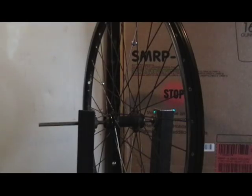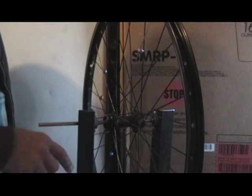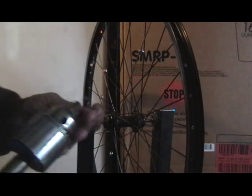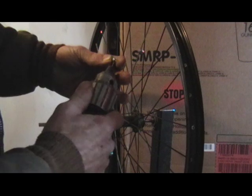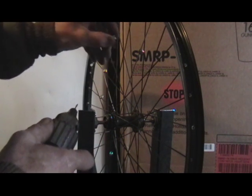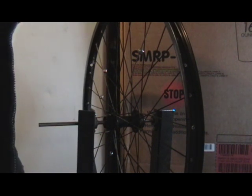Alright, this is going to be my final try. This is Zane, getting a decent recording of how to balance your wheel. What I use is split shot — I've taken a very small drill bit and put it across the inside of the rim, making sure I had a nice little slot in there so it'll clamp onto the wheel, onto the spoke, and then just squeeze it a little bit to lock it in place.